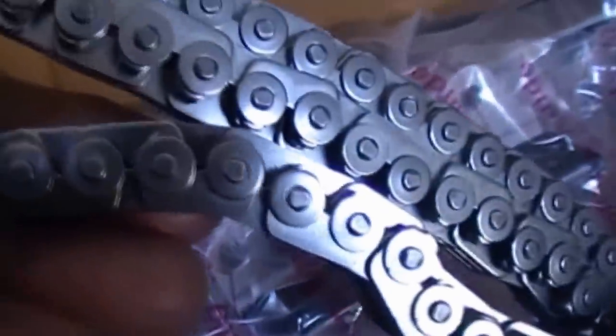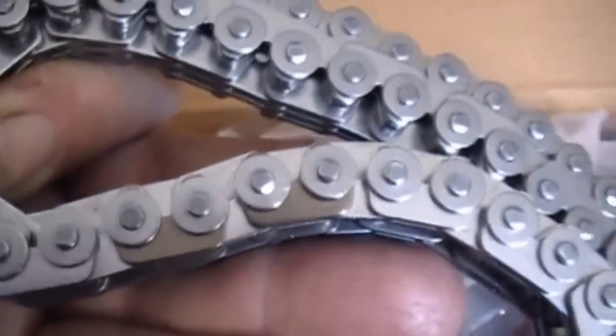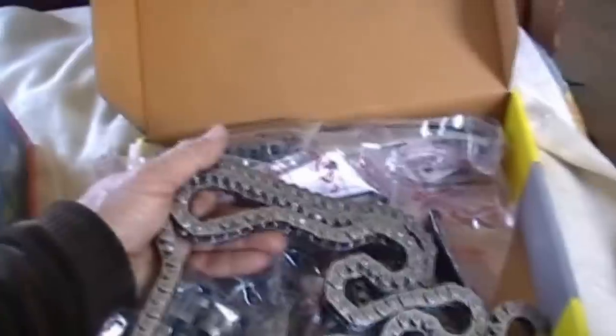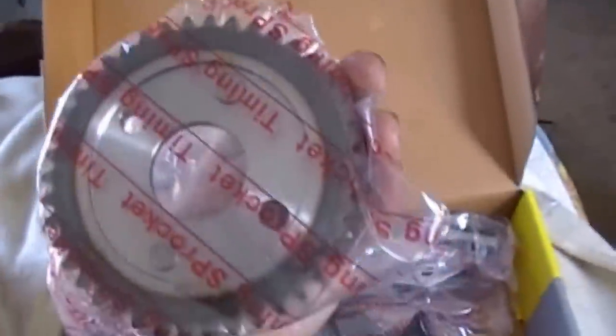See those links - they're a little darker. Those are the ones you've got to look for. To make it easier, take a little white fingernail polish and just mark those links so when you put the chain back on the gears, you can get it in the right timing position. You've got all your oil tensioners, your guides - which I really did need on that car - and your gears.